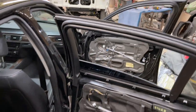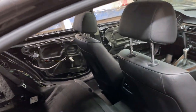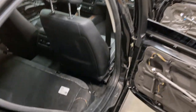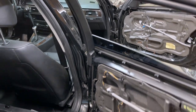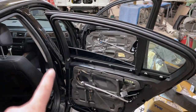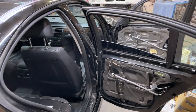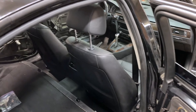That one had to be replaced altogether; this one just had to be put back on - those never came fully off, but they were loose. I've also tacked in all of the pieces down here along the floorboards, the kick plates, and I've also gotten the inner weather strip put onto this door. So basically, at this point, ready to start putting on door panels.